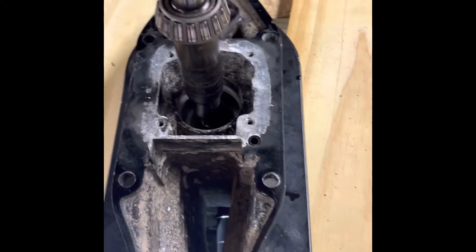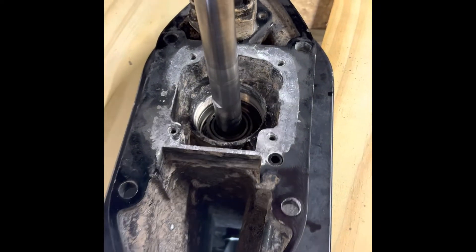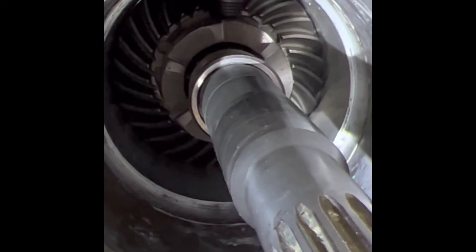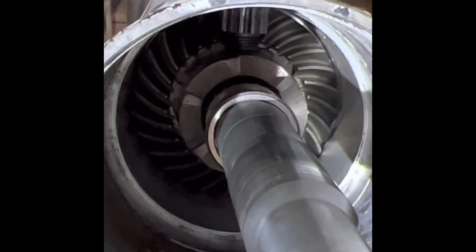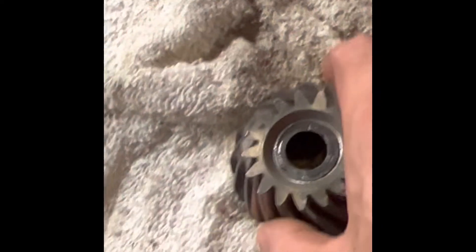We're going to set that slowly into that hole right there - just like that. The easiest way I found to do this: see where that little nut right there actually comes out. You put the gear in, pull the shaft up here slightly, put the gear on, hold it up still slightly with the gear on, and then you're going to put some Loctite on the nut. Make sure on your gear - there's this little shim on this gear right here. You need to make sure you have that on there when you put it back on, then put the nut back on.